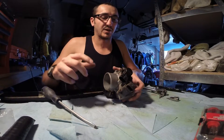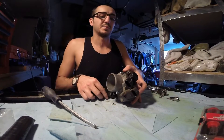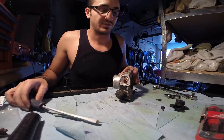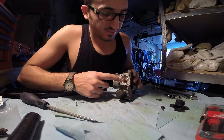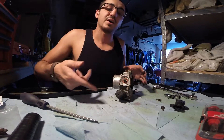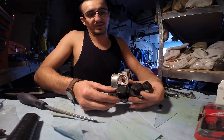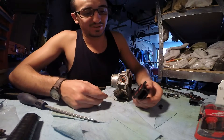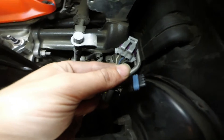If you want to use a DVOM, go to the other video I have. This TPS sensor is what we found to be the problematic area, but we're going to go ahead and replace this unit. Since we're not using a DVOM, we cannot accurately say 100% this was the problem — which is why I don't suggest this method — but if you're in a bind, this is the way. You're going to part match, and you should always pull off the connector and check to make sure all the wiring is good.